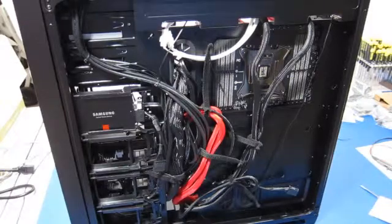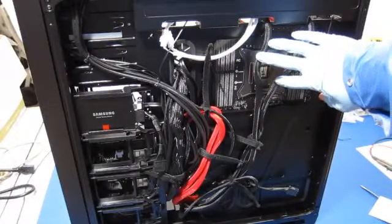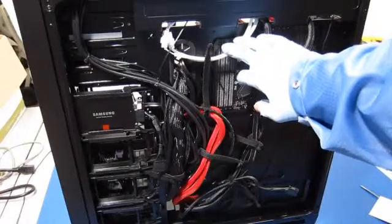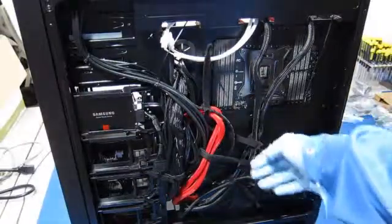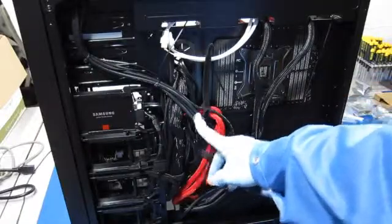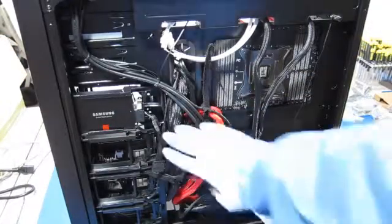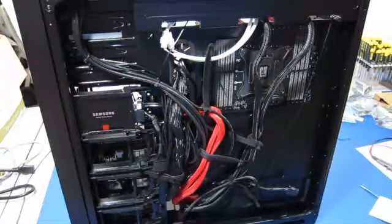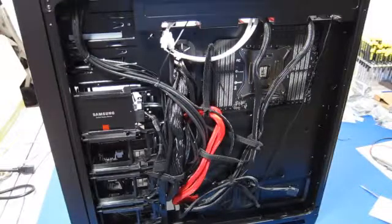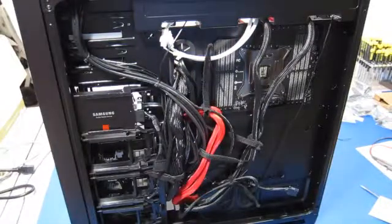This is the back side of the motherboard. You can see how the cables are routed: the scope power cables go to the top of the motherboard, the Phantek CPU cooler power cables, and the red ones are the power cables for the GPU. You've got USB 2, USB 3, and high-definition audio cables, motherboard power — the big heavy one — SATA cable and SATA power cable for the solid state drive, SATA data cable, and power cables for the hard disk. All the connections to the front panel are coming through here. It might be a little neater, but that's what we've got so far.